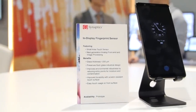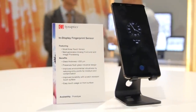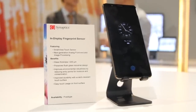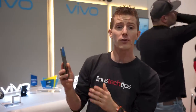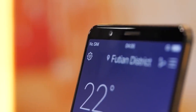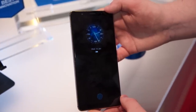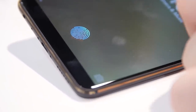The star of the show really is the display. It uses a Samsung OLED panel — probably a good choice. And like any phone these days, that display is kind of like a cake or an onion — it's got layers. There's a glass digitizer on top, then an OLED panel with its substrate, and then there are actually little holes that allow light from the panel to bounce off your finger and through to the sensor underneath it, reading your fingerprint.